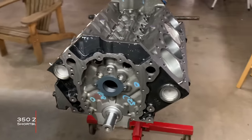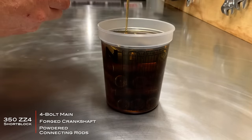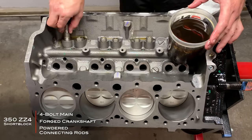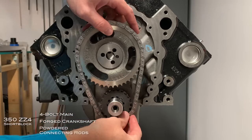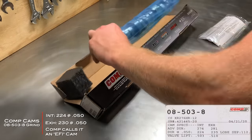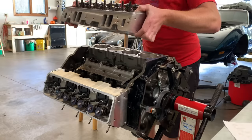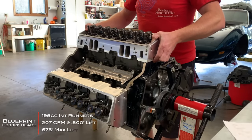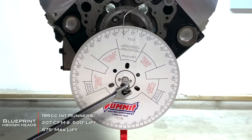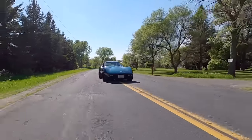For the motor itself, it's a replacement Chevy 350 with a ZZ4 bottom end — a four-bolt main. You don't really need it, but if you're buying a short block, you might as well buy a good one. One interesting thing I learned with fuel injection is you can run a more radical cam. I picked a 224/230 intake/exhaust duration, which I thought would be right on the limit of what's streetable — meaning able to run vacuum brakes. In reality, I'm fairly certain I could have run something in the 230 intake, even low 240, and 240 to 250 exhaust duration and still had enough vacuum for street use. No regrets — 224/230 is just fine, but it shows another benefit of running fuel injection.